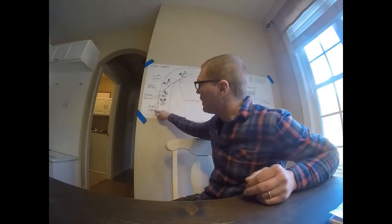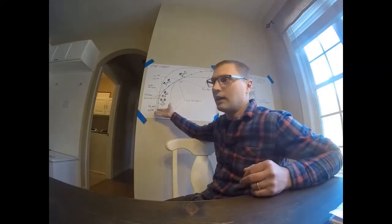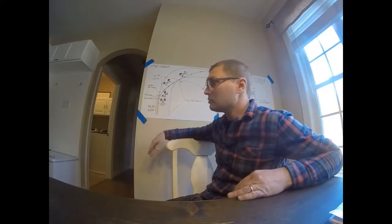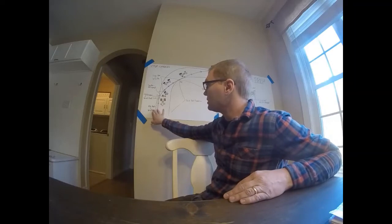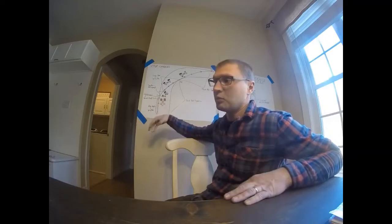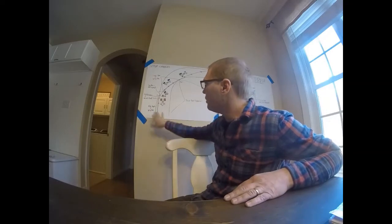With that said, I want to use the springs, particularly in the front, that allow that ride height. So in my experience, lower is almost always better. So I set my front springs. I use my rear springs to complement the front springs and get the balance that I want there.